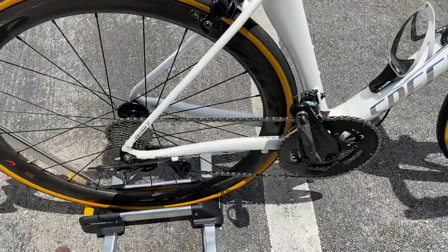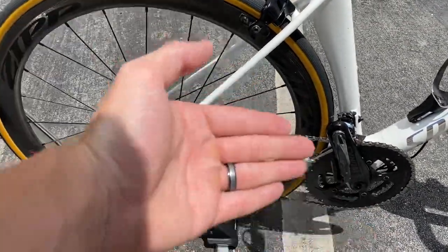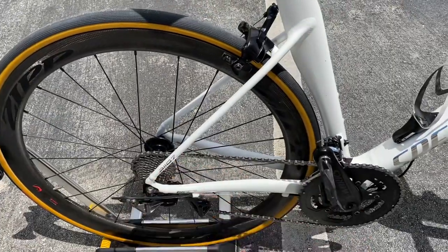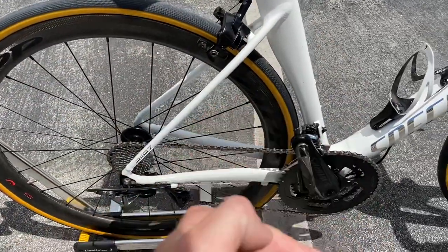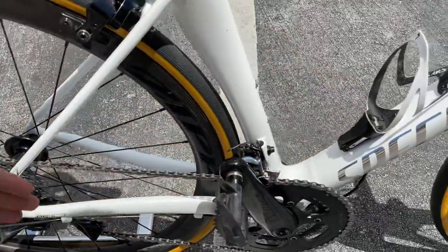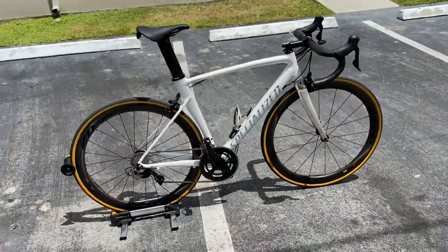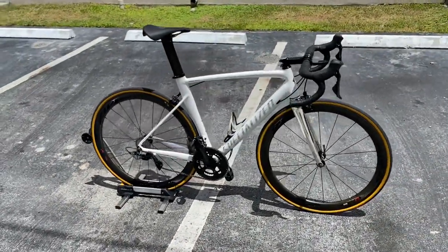You can see this frame has an all-white colorway with a chrome Specialized logo, which looks amazing, and the front fork is chrome as well — looks badass. They also shortened the chainstays to make it snappier and stiffer. The longer the chainstay, the more flex there can be, so when you're putting on power you don't want that lateral movement. Shorter chainstays mean power transfers immediately with no loss.